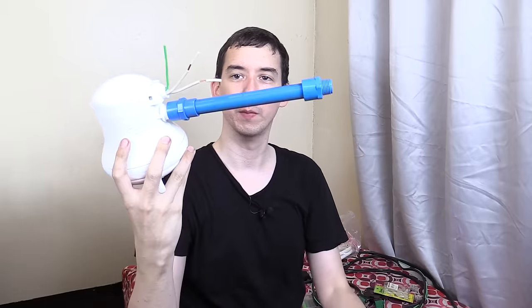I went to a small local hardware shop and bought one foot of PVC tubing and two little connectors so I can remove my old shower head and screw this one in place. I also got some Teflon tape — one foot of pipe and the two connectors for 50 pesos, which is under a pound, basically nothing. On the water input there's a little piece of plastic to reduce the flow; if you've got low water pressure you might have to remove this, but I've got high pressure so I'll leave it in.